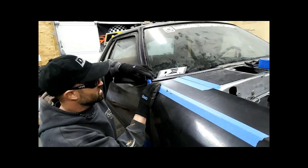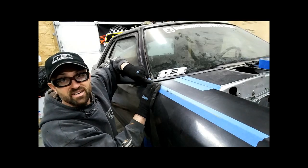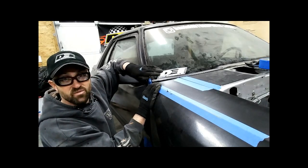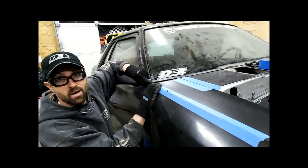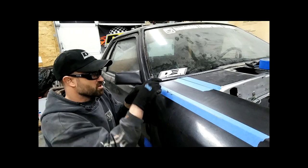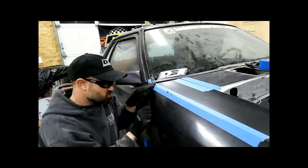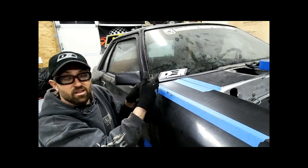But if you notice, this molding piece actually goes underneath of it now, which is great. I will need to extend this back, I think, just to be able to fill that in. And I may build up this surface here to take up some of this gap, but I won't know that for sure until I get these 2 halves together. So a couple screws, strap it this way and basically pull it down in, because otherwise it wants to pop up and get out of the way.